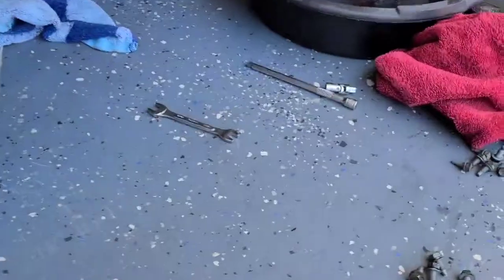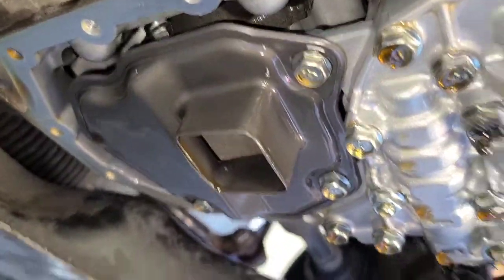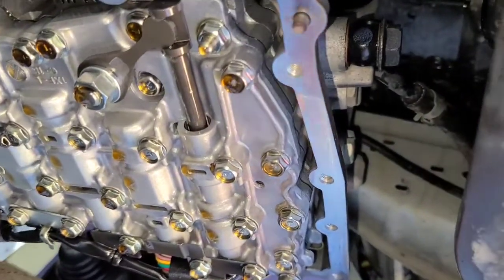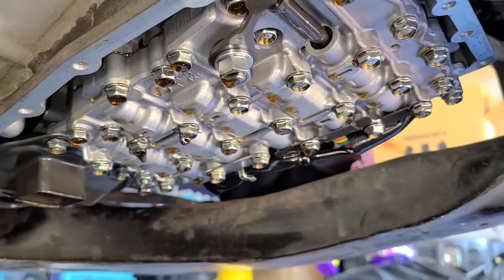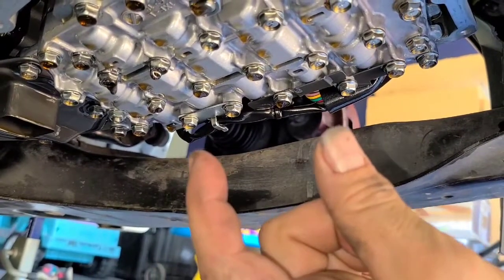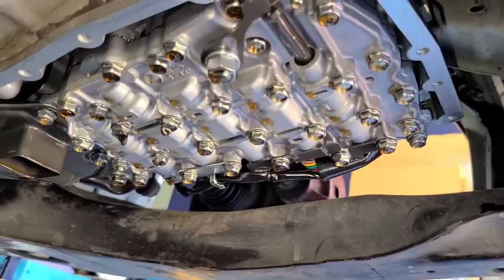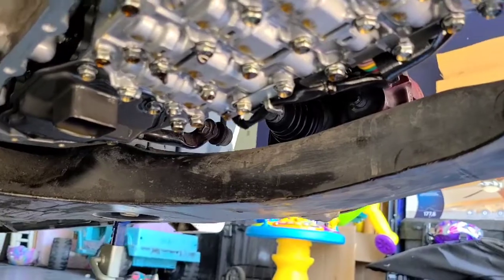I will take a quick look under the car. There's the strainer - I'm gonna take that off. There's one, two, three 10 mil bolts. I'll take those off, pull it down, swap it out with a new strainer. Everything else looks pretty good. There wasn't a lot of shavings or metal on the magnets, so that's a good thing. I didn't see any of those little pieces of metal, little thin blade-looking pieces that come off of the push belt. If you find those in your pan, you got problems - the push belt's falling apart and you're gonna have to do some major work.